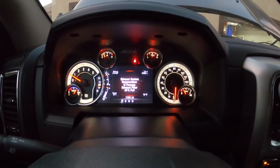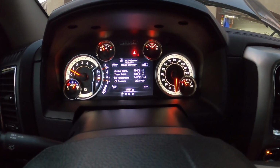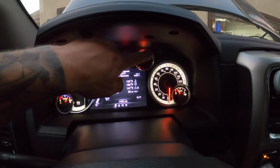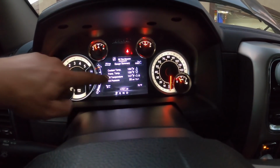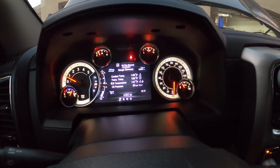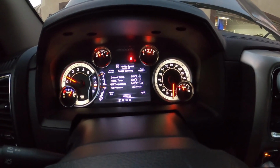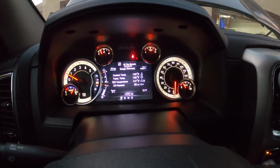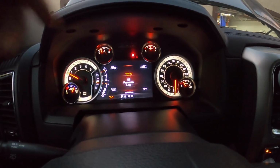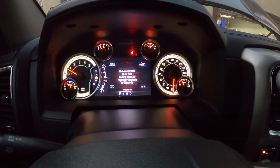All right, guys, so I just did see it act up. So see, our gauge is in the middle there, and watch, see how we're sitting at 20 PSI? It'll sit here and just drop for no reason all the way to nothing, and you'll see the indication come up on the dash here, watch. There you go, see it? See how it's acting sporadic though? Like, the pump isn't an issue, it seems more electrical. So see how we're perfectly fine? Look, drops down to nothing, flies all the way back up to normal oil pressure. So there you guys go.